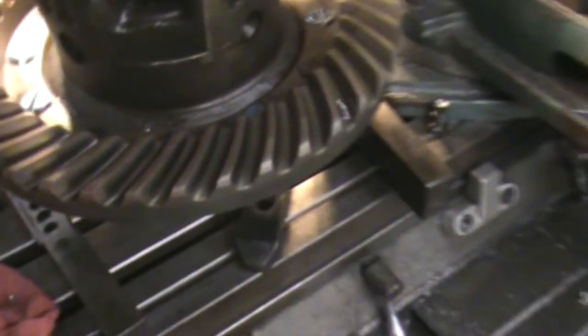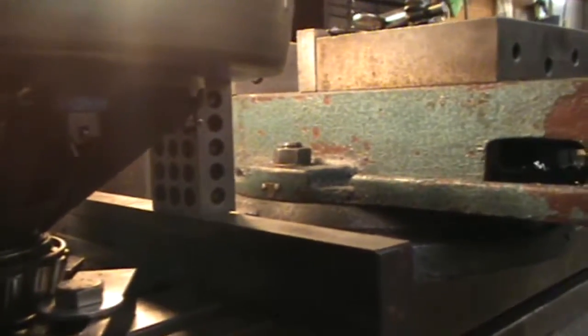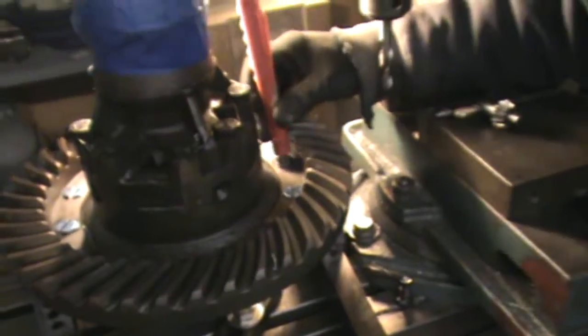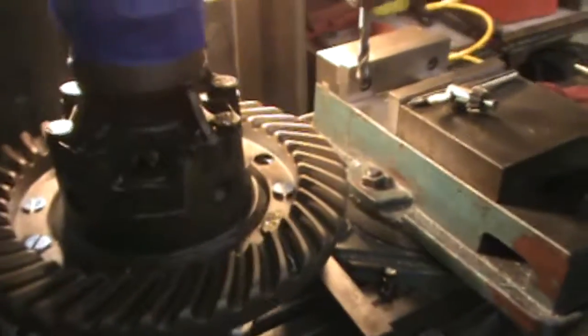You can buy them. And then we simply put them in there and torque them up to the recommended torque for a seven sixteenths twenty bolt. We're using some washers underneath them too. You can see how that head comes out of there. So now we can put our bolt in place of them and torque them down. That's our way of fixing our problem.